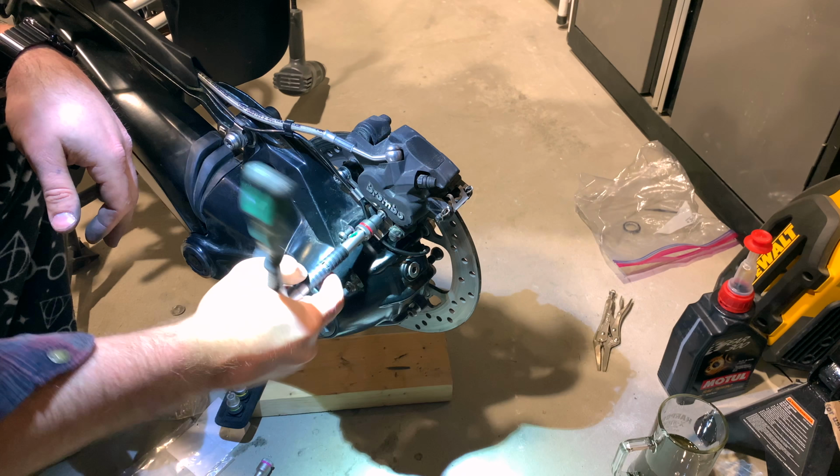So first, 180 milliliter 75W90 gear oil. Motul is fine. You can use the BMW as well. The thing is, the final drive fluid in this 2018 GS Adventure was actually only changed 1,000 miles ago. It's not due yet. Here's the thing, though.